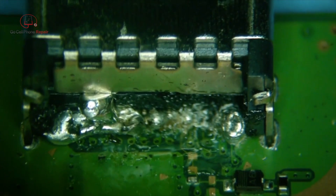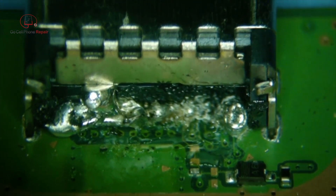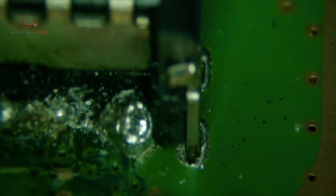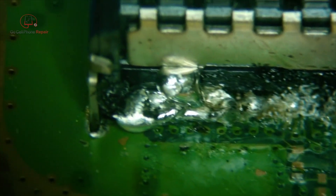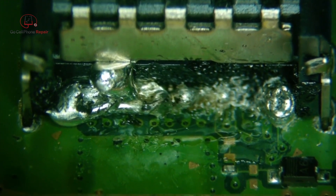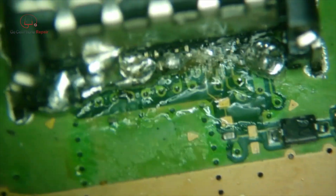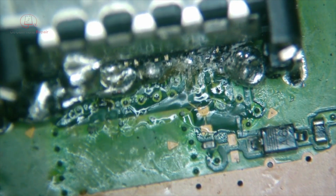I'm assuming they got the old port off the board. Judging by the anchors, it looks like they actually did take the old port out somehow, which is scary because I don't know if any of these traces are going to be still attached to anything. Then I guess they just jammed a soldering iron in here and figured if there was some solder on there, everything would be fine. I'm going to remove some of this stuff just to see what we're working with, because I have a feeling this is going to be jumper city. I don't want to get too deep into this until the customer knows this is not going to be a standard repair — the price for an HDMI port in this case just went up significantly.